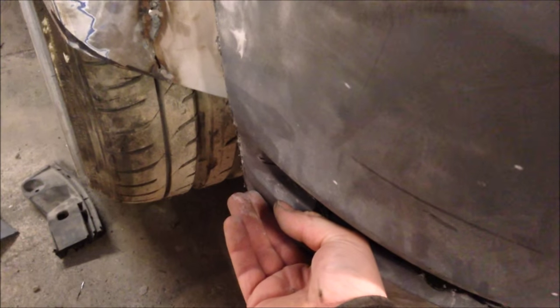So I've got to work on this side. Now, I can't just bond it together because basically there's nothing to bond to. So what we're actually going to do is plastic weld this piece. I've got to let my soldering iron heat up, and we're literally going to try and fettle it about. I've looked from a distance at this curve. I think what we're going to do is get the heat gun like we did the other side and just slightly, you know, like that in there, so both curves match.